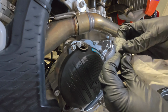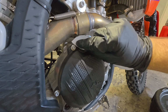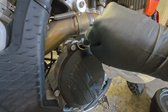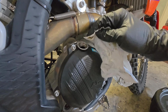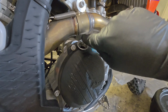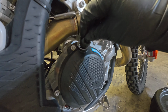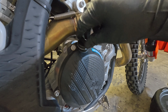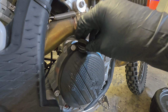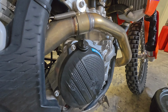You want to be careful when you're cleaning the portion on the clutch cover here not to knock any debris in, so you're going to clean away with your stroke from knocking anything in. Notice how when I do that, I'm being very careful that anything gets pushed out. Another thing I do is I will leave the cap in as I do the procedure, but I leave it kind of loose. This creates an air gap that can assist in the draining of your fluid. So just put that on there, but don't tighten it snug at this point.